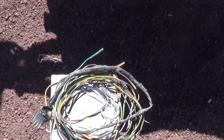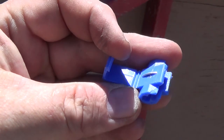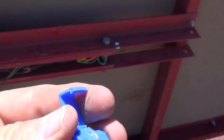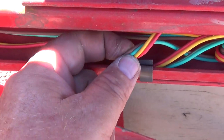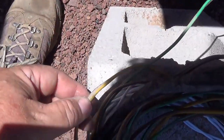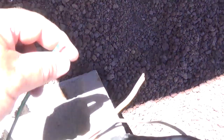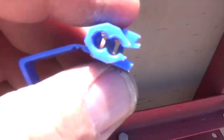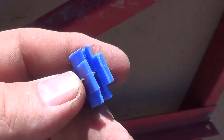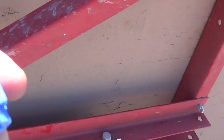It was very simple, but one thing I gotta caution you on if you are going to do this: these guys are fantastic. The only problem I had was this wire — this replacement wire is so incredibly thin. I think it's gauge 22, which is actually thinner than the wire the trailer came with. I think the original is 16, maybe 18. When I tugged on the wire it actually cut the wire in half, so I didn't have a connection.